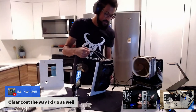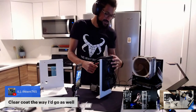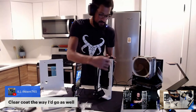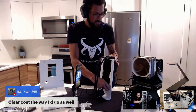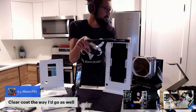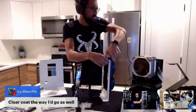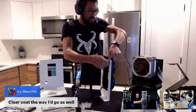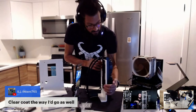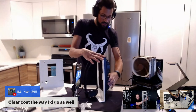Yeah. So here we go. There you go. There's the back plate. There's the AIO on it. Actually looks really nice and compact, which I love. And then what I did is I used the fasteners that come with the case, and I just hand tightened, which I know they're very small. I know it's not something you would typically want to hand tighten, but it's just how I prefer to do it. And then to make sure I'm snug enough, I just apply a bit of pressure, almost like a pinch. If there's extra give, I tighten it, and then I'm pinching in the same star formation that everyone always tells you to. That's absolutely the right way to do it. And testing for wiggle, and we're good.